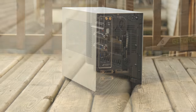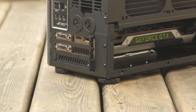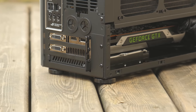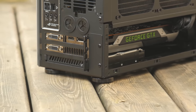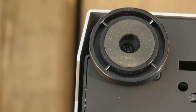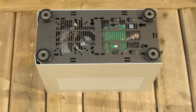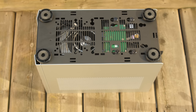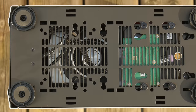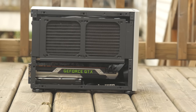The space taken up by my rear radiator fan would otherwise be reserved for clearance for a CPU air cooler. Around the back we find mounting holes for an 80 or 92mm fan — I opted to leave this empty since my dual 120mm radiator fans are pressure-optimized models configured as intakes, with the rest of the case acting as passive exhaust. Back here we also find external water cooling grommets, an I/O for the motherboard, and curiously three PCI slot covers, allowing up to a triple-slot card. In the bottom, thanks to the feet keeping the case up off the desk, there's room for a 120mm fan in the back and front, though neither is possible with a hard drive installed.